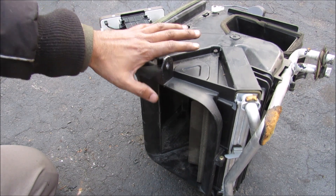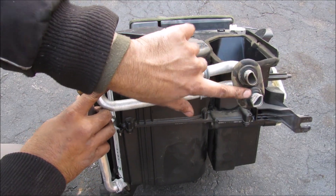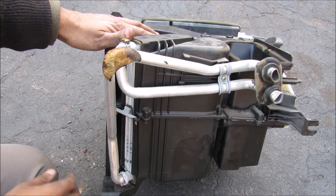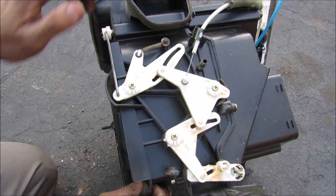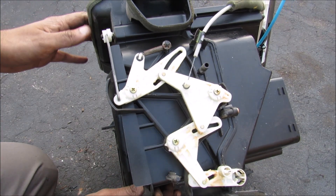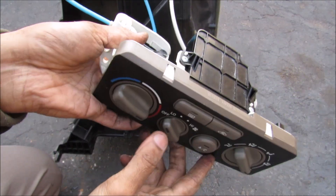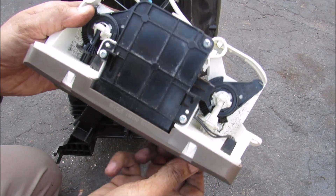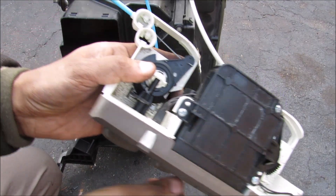Let's have a look at the mixer box and heater core assembly — these come together. Over here you've got your inlet and outlet for your coolant that comes off of the engine and that warms up the heater core on the inside here. On the side here we've got a couple of actuators that actuate the warmness and coldness of the air as well as the direction of the air. If you look closely at the controller you can see how it works for the hot and cold and for the mode — as I move the dials over here you can see that it actually actuates a cable.